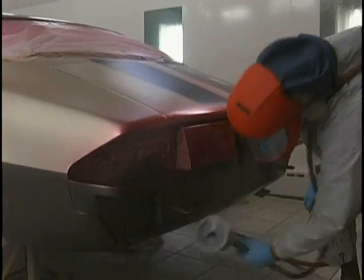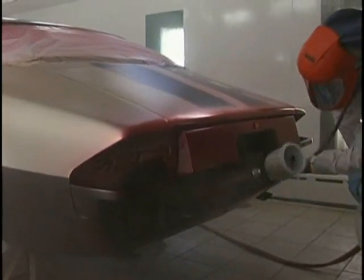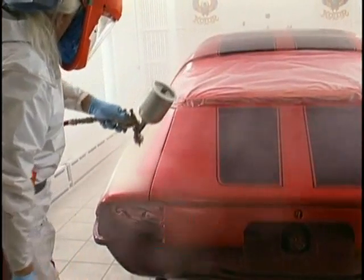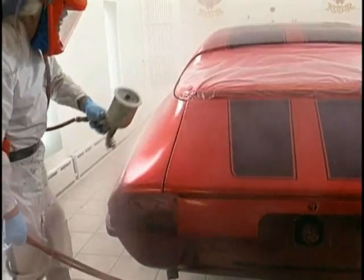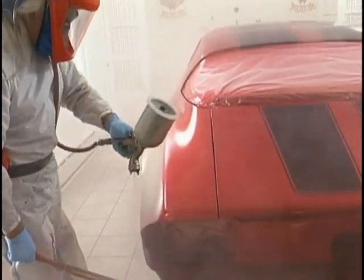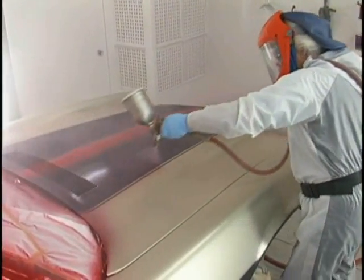I've had more painters take cars outside after they're done and say, what do I do? I didn't get enough paint on the rocker. Continue, straight line, invisible straight lines. Hit where we came down to that sail area and stop. Band, important banding. Now we get up to the hood. We haven't done the sides yet.